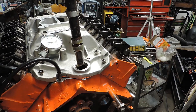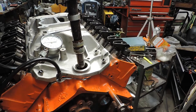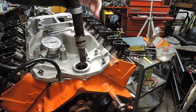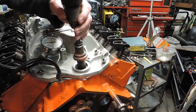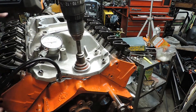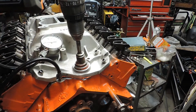This is the pump I built — pretty straightforward and simple. It's just an old distributor. I ground the gear off down here, cut off the top, and welded a washer on so it won't drop. Then you plug in an oil gauge so you know what kind of oil pressure you've got. That's how simple it is to build one of those.